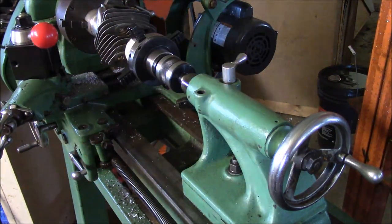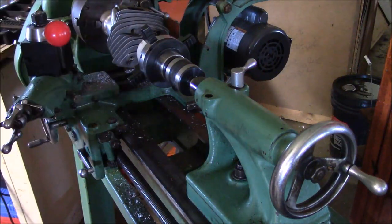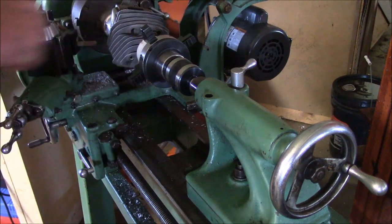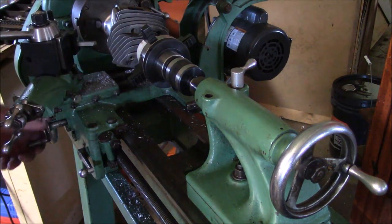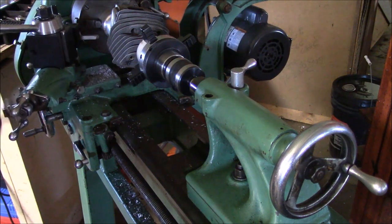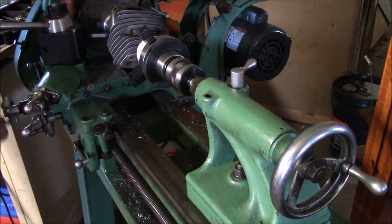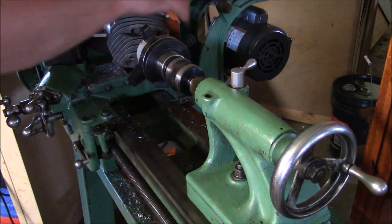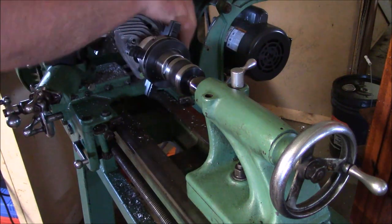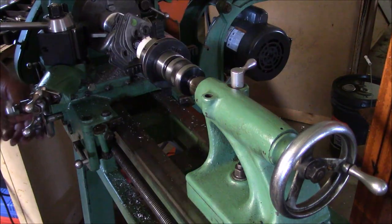And I already have the tooling set up. And I have the center set with this lock nut deal. So all I have to do is slide that down, lock it. It's done. Now, what that does is it gives me the ability of getting in here. And you always check this, you know. Never not check this, and make sure that when you are very close to the end of your cut, you actually don't have anything that's going to turn around and smack and create a collision.